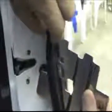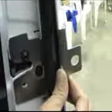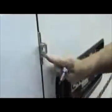Slide the bracket through the weather stripping. Reinstall both retaining bolts. Gently tighten them. Close door slowly, making sure weather stripping doesn't grab in between brackets. If clearances are acceptable, shut the door firmly and align lock mounting holes. Open the door gently and finish tightening the bolts all the way.